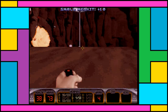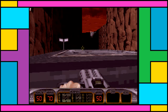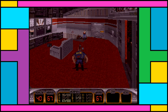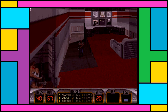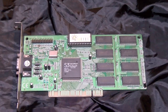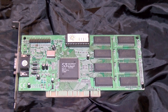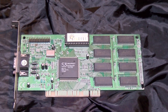Overall, the experience is quite indistinguishable from any other 486 with a similar configuration. I'll be pitting it against an AMD X5-133, as that's what I have the results for on hand, plus the X5 has a 486 core at the same clock speed as this one. So it does seem like a reasonably fair contest. However, the AMD does have L2 cache available to it on the motherboard, where the STPC doesn't, as well as a PCI video card. There is no doubt that the AMD system will perform faster as a result — if not the Virge, then the L2 cache — and just the fact that that motherboard is geared a little more for performance, whereas this one is geared to reliability only.